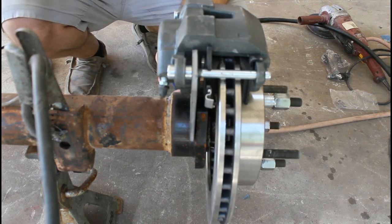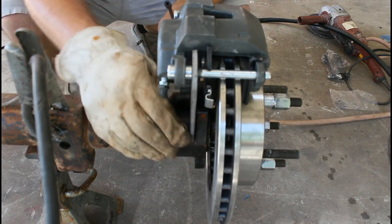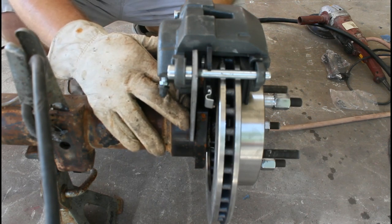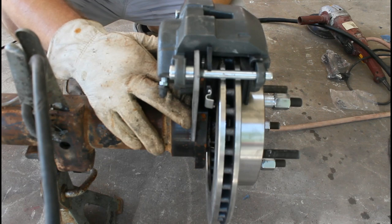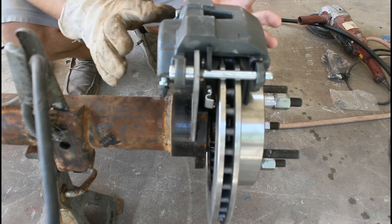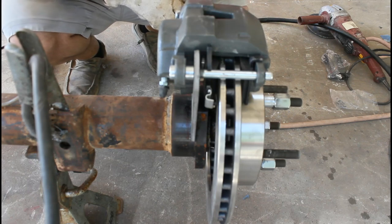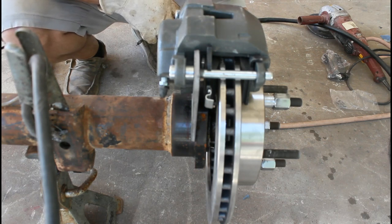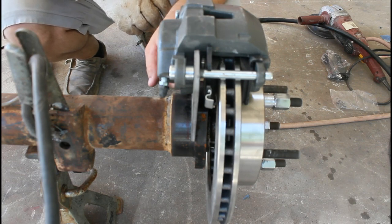See how it all squeezed together? Now you can see there's a gap between the bracket and the flange here — I want this to be flush so I can get maximum clearance. I'll hit it again with air and push the bracket over at the same time. Now it's square. I'm using new pads — I wouldn't do this with an old set because they'd be uneven. But I've done this before and it works really well. Now I'll apply pressure and weld this in at the same time.